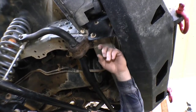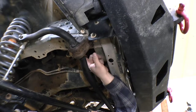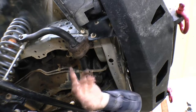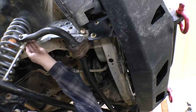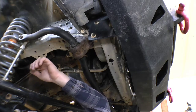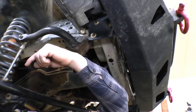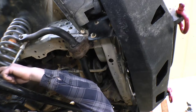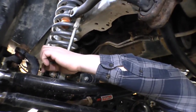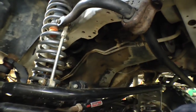What I've got is every bit of an inch between the back of this bracket and the frame because it actually turns after this bolt. I've got my link installed right here - I've actually got it on the inside, so the mount is on the outside. I've got the other side mounted on the outside too, just because of the length. I think I'm going to turn my tires here in a bit and see what kind of clearance I have. I might flip my pins to the outside - then they'll both be on the outside and it might be easier to take off and put on when going off-road.